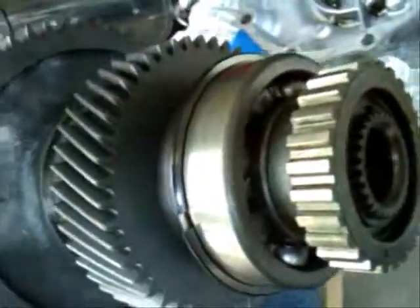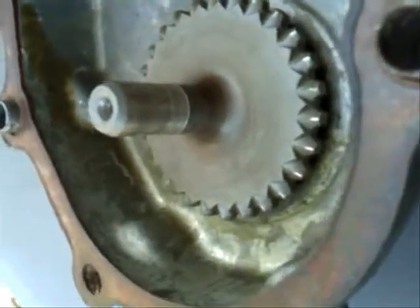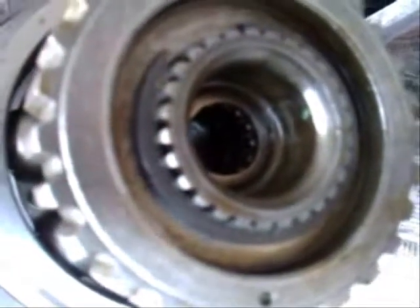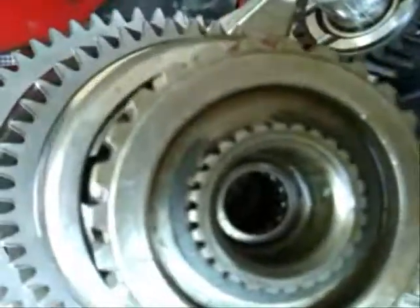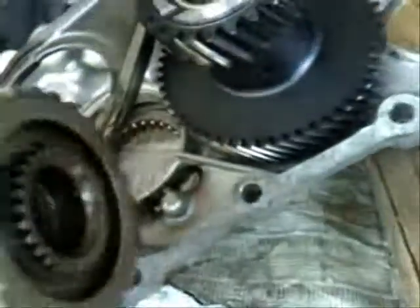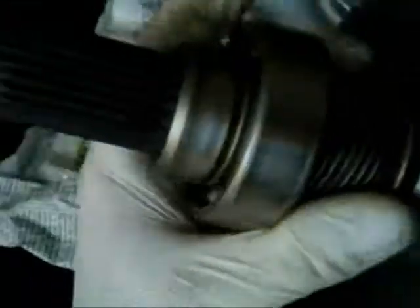This is where the front shaft went in. You see how it looks like the transmission front shaft with the little tip right there — that goes right in there. There's a needle bearing in there; I have no clue how to remove it, so it's gonna get reused. Plus, needle bearings pretty much don't wear out. There's a C-clip right there holding that on, and the front selector sat on that. You got a big bearing with a C-clip to hold it from going past that. You can see where it sits down. Then you got a washer, and that's part of the high gear assembly, and low gear, and another washer.